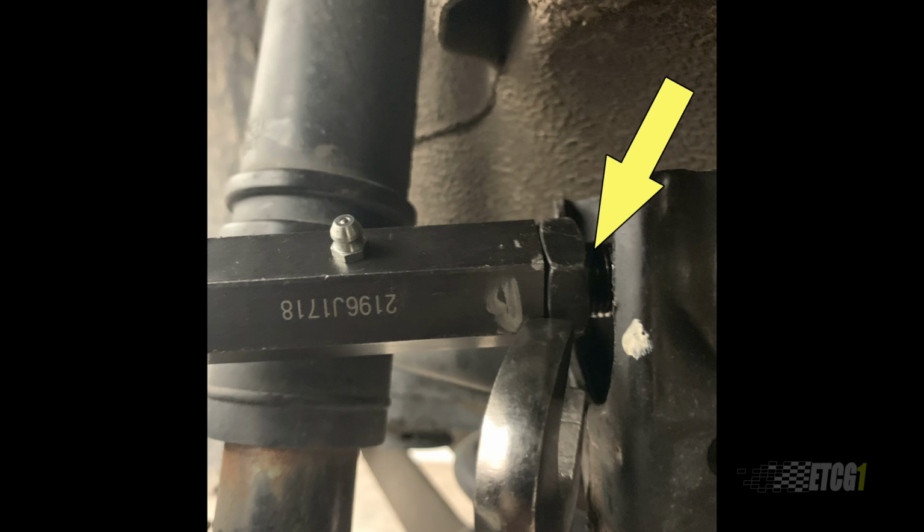The reason I did that was because the lock nuts, where that control arm attaches, are somewhat recessed inside the body, and it's very difficult to get a wrench on that lock nut. So I left those threads to move that lock nut up far enough to make it more accessible so that it could be turned. Anyway, after doing this and fighting with the lower control arms and the cam bolts, which video will be linked in the description, I took it back to the alignment shop. They were able to line everything up, and everything is good now. So all is right with the world.